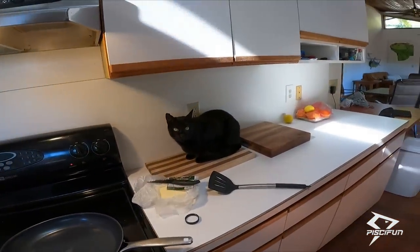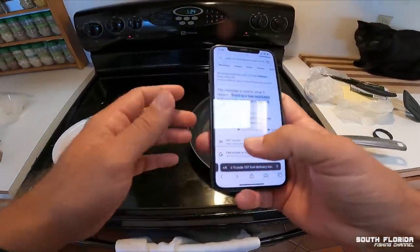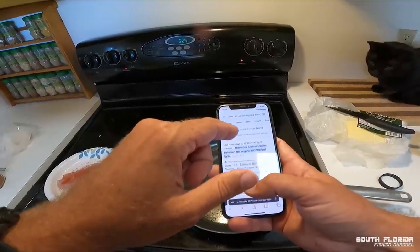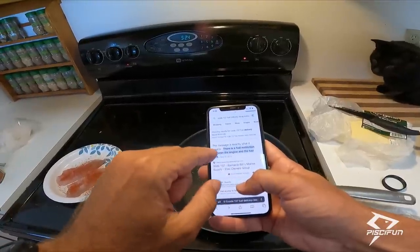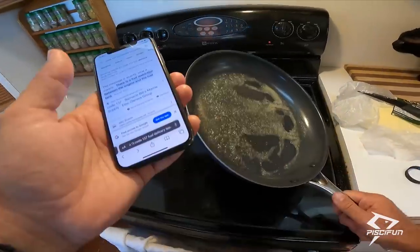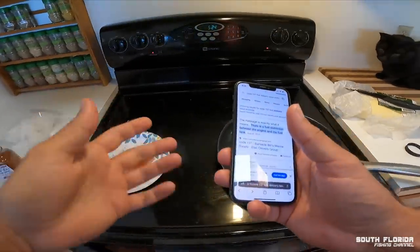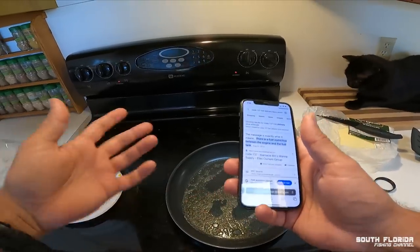Hey, buds. How you doing? I did want to mention, I had an alarm go off on the ride back with Dan, but I didn't get it on video. But I had an error code come on the Evinrude little computer thing, and it said code 137 fuel delivery issue. And I looked it up, and it says that there is a fuel restriction between the engine and the fuel tank. This error code has come up a couple times, but I don't know how a fuel restriction would cause a spike in RPM. And I would think that the engine would have a hard time running over 2000 RPM, because anything over 2000 RPM, the engine runs great and smooth. It's just like an idle and stuff.